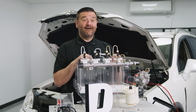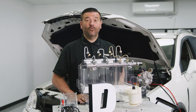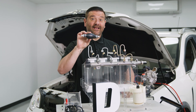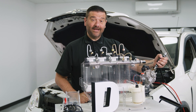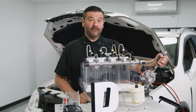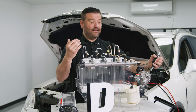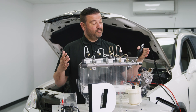If we don't have an electric in-tank pump, hopefully there's a hand primer on the filter housing. If not, take a piece of fuel pipe and a manual hand primer, put it in line up to the fuel pump inlet, and pump it to bring all the fuel up. That way you've only got to deal with the section between the pump and the injectors.